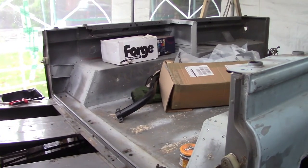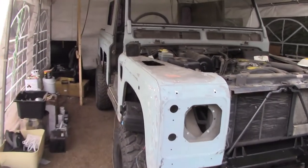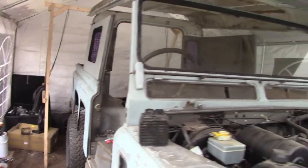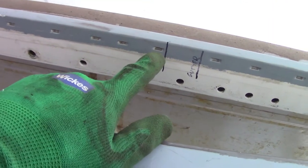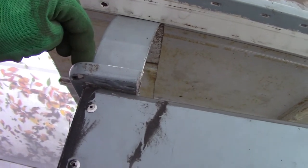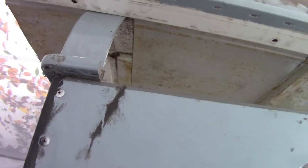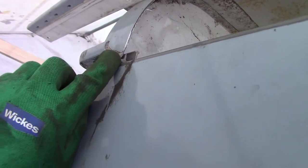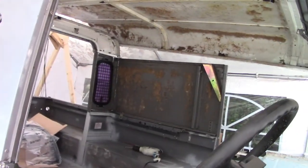Now I'm actually going to do what I intended — build up this back end, get this roof marked and get this chopped. I've reassembled all the sides, that back roof bit is all bolted on, re-bolted the windscreen framing and the screen, just so I could lay the roof up on top. I've had this lid right up against the back of the screen and in place, so I've just got a couple of marks. This is going to be the back of the roof, and that's just where the overhang on the gutter is, because the intention is to have the roof come right to the end of here, and then I'll have to reconnect these two which will involve the roof skin, basically taking out all this putty and refilling it on top of the new skin.